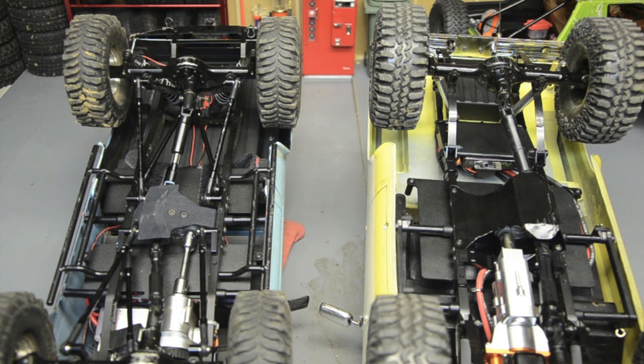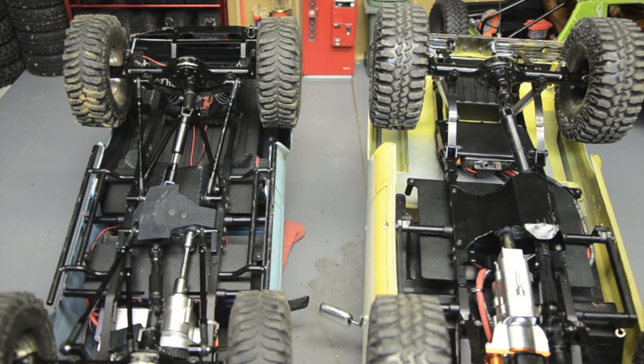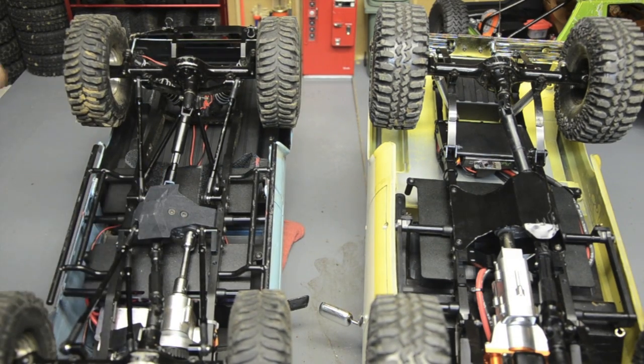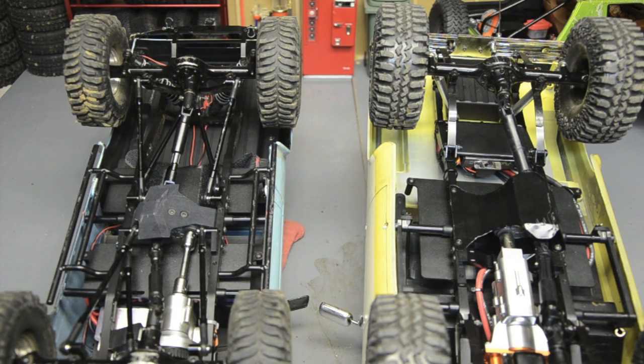First, the shafts I put on this truck are the 3.56 to 4.5 inch, and in millimeters, that is 90.5 to 114.8. That is what is recommended for the stock Trail Finder 2 replacements. But since we have the transfer case raised in the body, the front's too short. So the next option is the 100 millimeter to 118 Punisher shaft, which is 3.94 inches to 4.65.